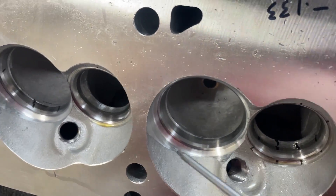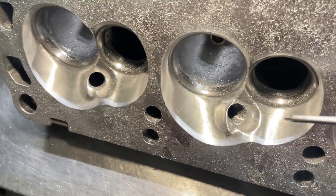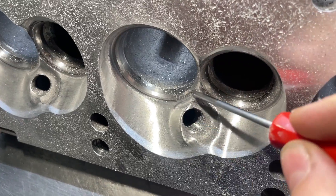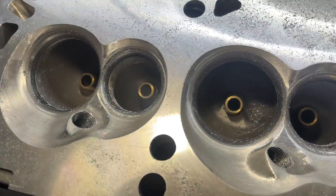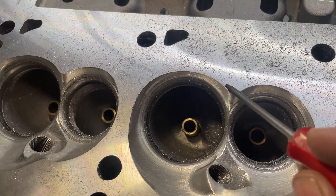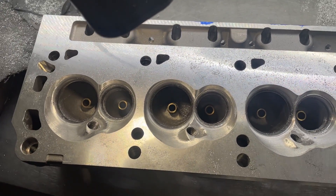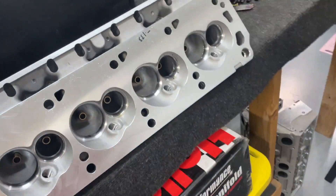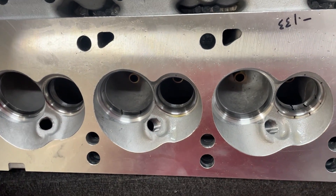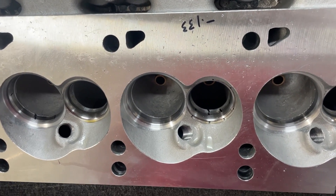The first thing to do was to address that ledge. I've got one chamber done — you can see it's been split out and rounded, and it's worked into that area too. On this side the head's dirty because I'm grinding on it. There's one of the first things to be done. You might say, 'Well, didn't you increase the chamber size?' Chances are the chambers did increase because there's quite a bit of metal that ended up being removed to make that work.